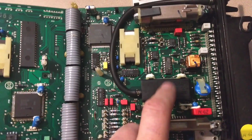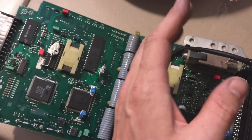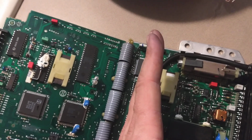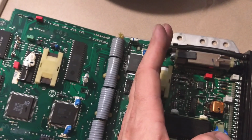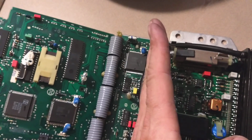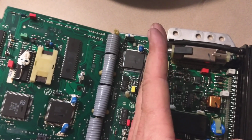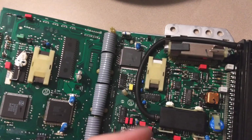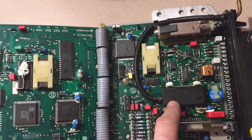So there's a crystal in here. It's a really thin, crystalline material. I forget exactly what it is, but as there's vacuum on it, and this line is being sucked on, it pulls it like this, and it measures the pull to measure vacuum. The same with boost. It measures how far it's being pushed to measure how much boost there is, based off the reference of 0 in the center. So if you ran more than 20 psi in this, you would actually crack that crystal,